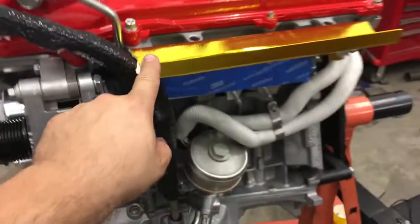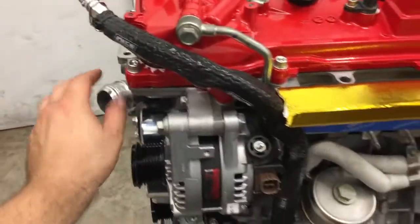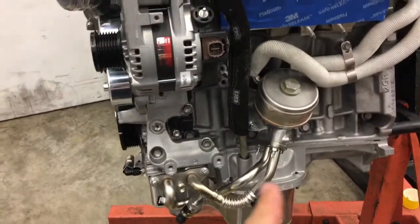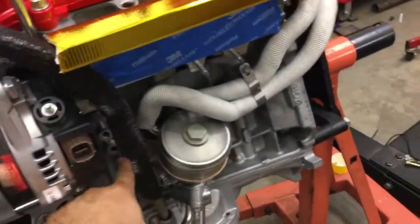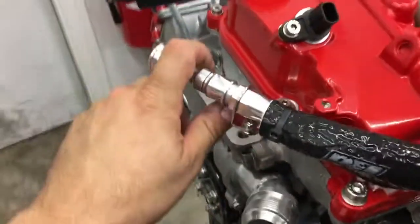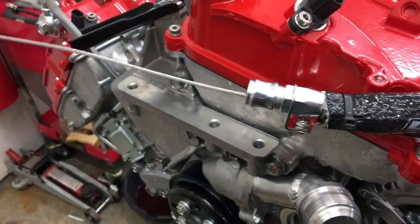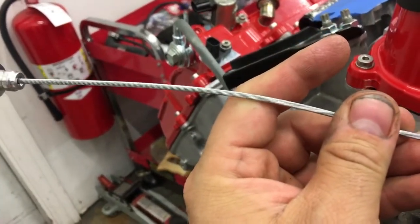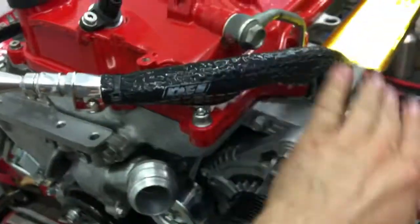Here's our engine — we've got a couple of additions before I wrap up for the night. You can see we've added a heat shield that goes on the front side over the exhaust manifold. That coolant line I showed you earlier goes right over the top here. We also have a dipstick — it's got a half-inch NPT fitting welded onto the bottom, braided stainless steel, with a DEI heat shield added over the top since it sits right next to that manifold. This thing actually locks into place and you just push in on the little release collar for the dipstick to come out. It's braided stainless just like the regular MR2, and it slides in and out smoothly despite having to go around some pretty cool bends.